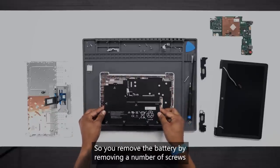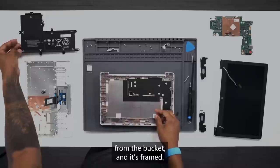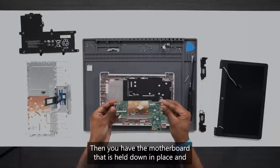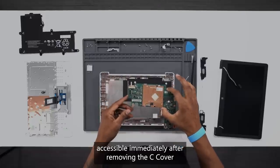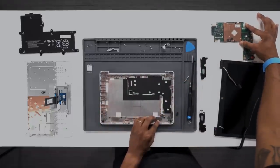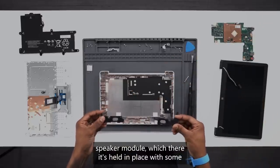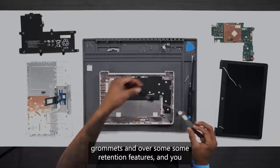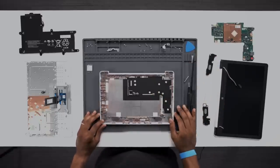You remove the battery by removing a number of screws from the bucket — it's framed, so it's pretty nice. You can just remove it, no adhesive. You also have the motherboard that is held down in place and accessible immediately after removing the seat cover with four screws. The last major component is the speaker module, which is held in place with some grommets and retention features, and you simply pull that out after disconnecting it from the motherboard.